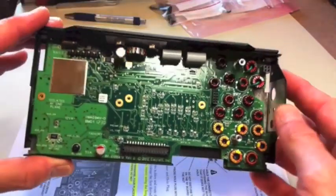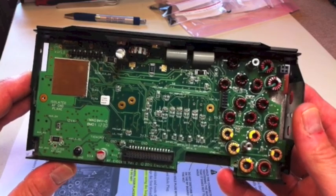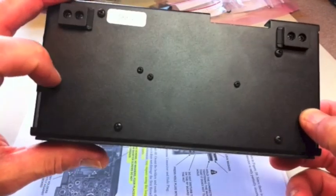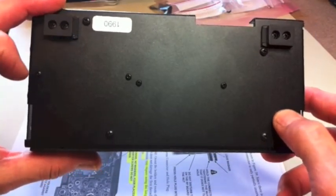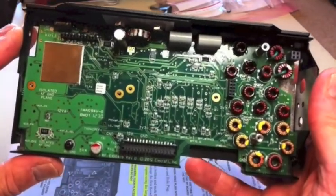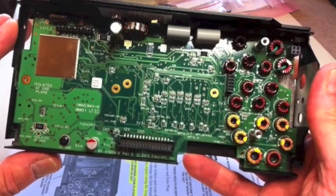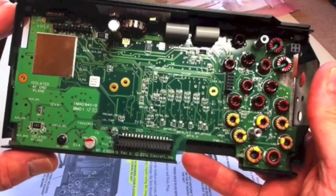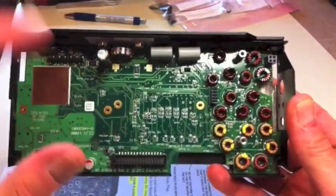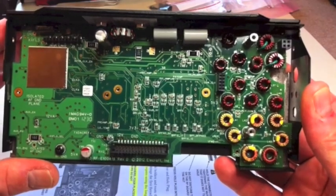That didn't go so well, and I've been reading about this on some posts and saw a couple of videos about it. It's a better idea to flip the cover over — here are the screws that secure the standoffs in place. The best thing I found is to loosen these screws, which gives the standoff underneath the board a little bit of movement, and the screws go in no problem. Loosen off the base screw, secure the battery compartment, then go back and tighten that screw on the back cover and everything will be secure. When those standoffs are tight, they really don't line up all that well, so you'll be much better off loosening them first.